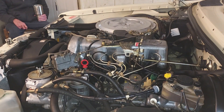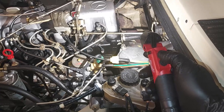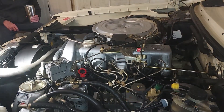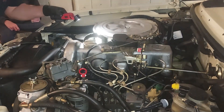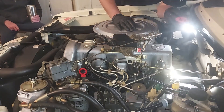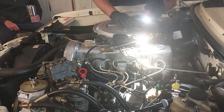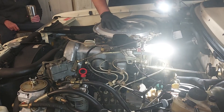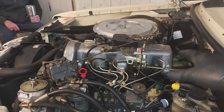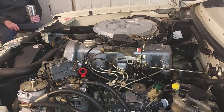Now what we want to do is look around the back of the engine for any leaks in that valve cover because we just put it back on. Back here is where they tend to leak if they're going to — but we're looking good. I'm really happy with the idle. Also the vacuum system is real healthy — you saw how quick the engine shut off. It should shut off within one to two seconds of turning that key, and it shut off almost immediately, so it's got a very healthy vacuum system.